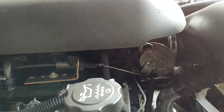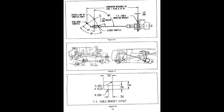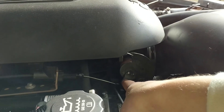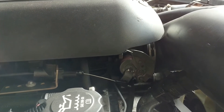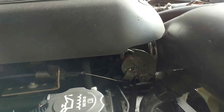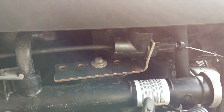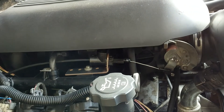First you need to get the cable geometry correct. The best way to do that is with a protractor and a ruler. Right here I cut the cruise control nipple off of the drive-by cable throttle body and flipped it around to where it needed to go. Next you need the mounting bracket — I'll post a drawing of this. I used the third hole back from the vertical and bolted it straight to the fuel rail.